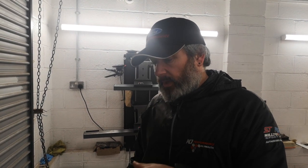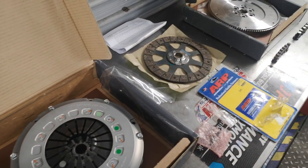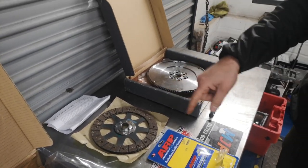It just helps considerably with the power and the torque. It'll apply the torque and the pickup pretty much the same as OE, so you get that OE pedal feel. If you put two ceramic paddle plates in there, blimey, it'd be like on off. It'd be completely like a race car, which is complete overkill for the road.